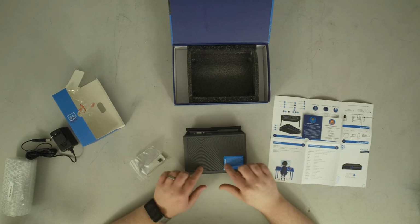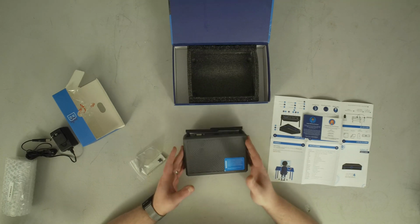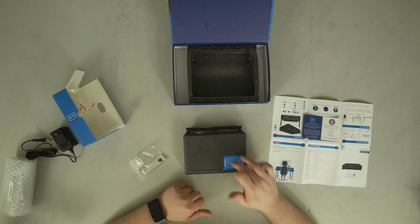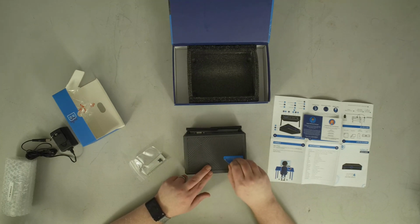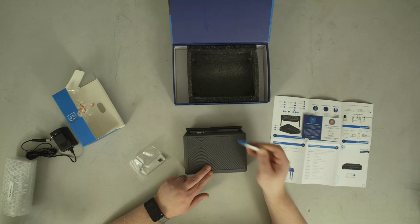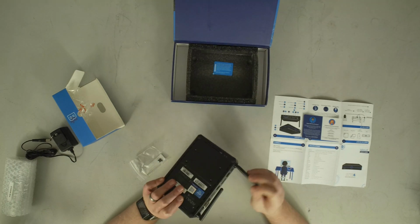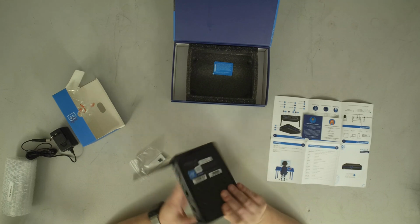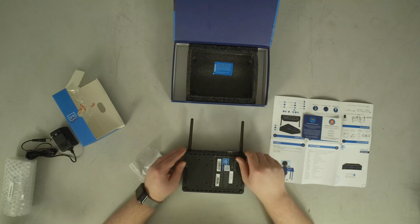So somebody must have asked them a question, why is my chip running at 1 gigahertz instead of 2 when I'm sitting at the desktop doing nothing, for them to have to include this sticker. Long story short, the CPU is going to have turbo bins. Once I know what model CPU is in here specifically, we will discuss what those turbo bins actually translate to, because they're different on different chips.